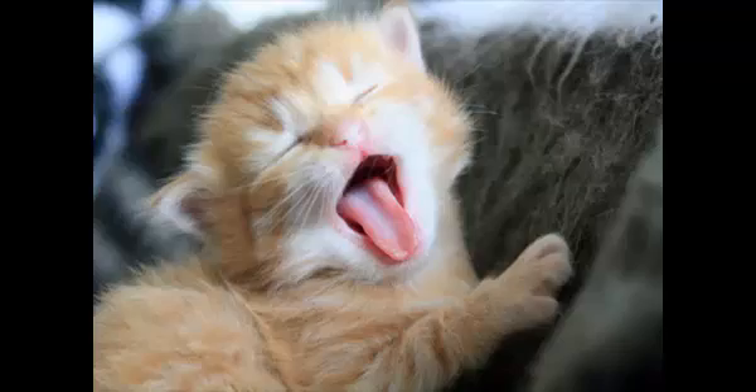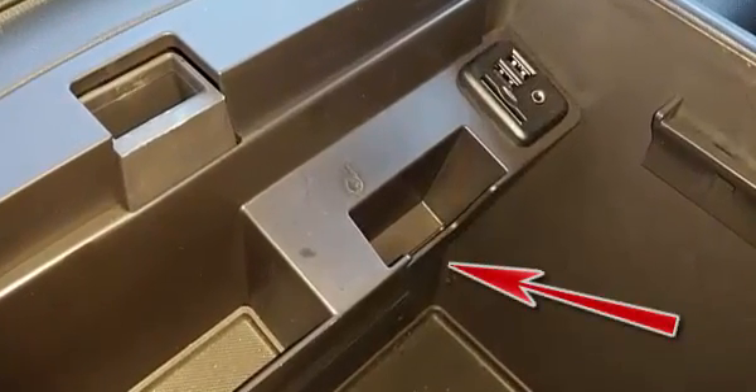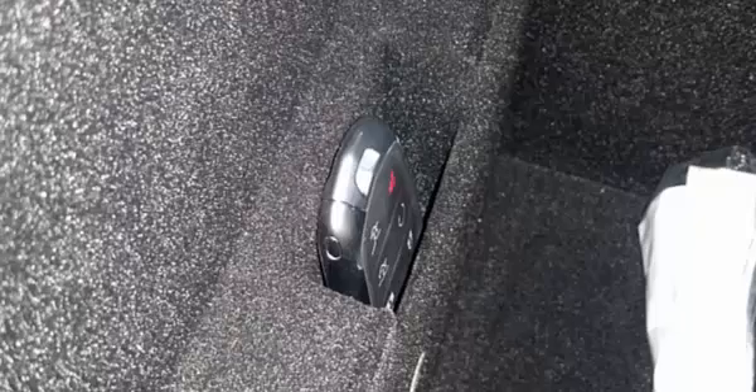Don't go to sleep — we're going to start the car now. To do that, locate a pocket at the front of the center console storage area. In the Escalade, it could be difficult to see without the flash we used. In other GM SUVs, it is closer to the top of the console and more to the right and easier to see. Slip the key fob into the pocket with the buttons out and the key ring up. It is a loose fit, so don't be concerned. The car will recognize the fob even if the fob's internal battery is dead. Step on the brake and press the start-stop button as you normally would, and you are underway.